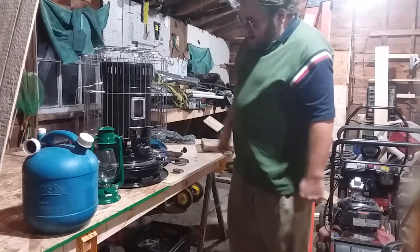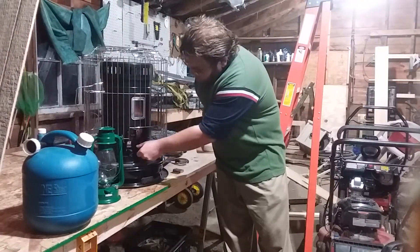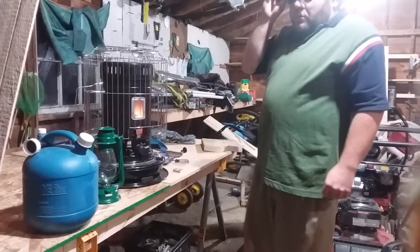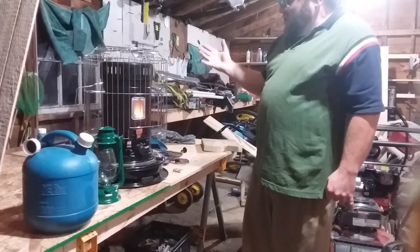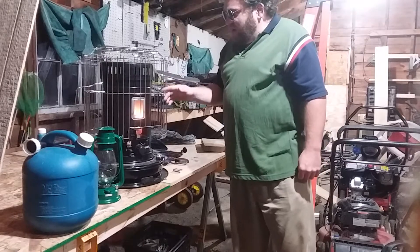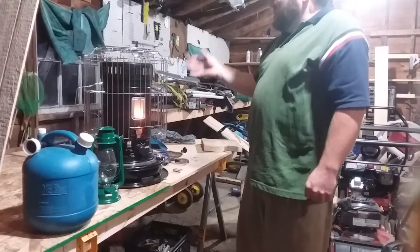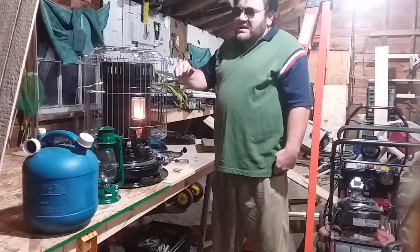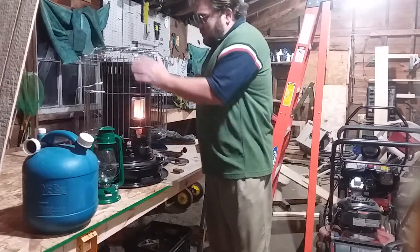Now that it's glowing, this little window will show you how it's glowing. There are a lot more detailed videos out there explaining how to properly run kerosene heaters, but this is just me showing you what I know. If you see a lot of smoke, that means your wick might be dusty or dirty and you want to clean it off beforehand — you want a clean-burning wick.